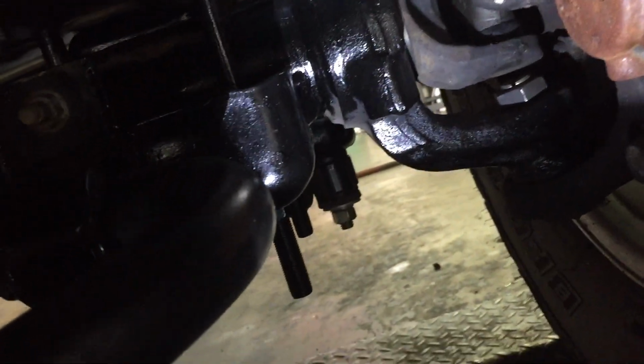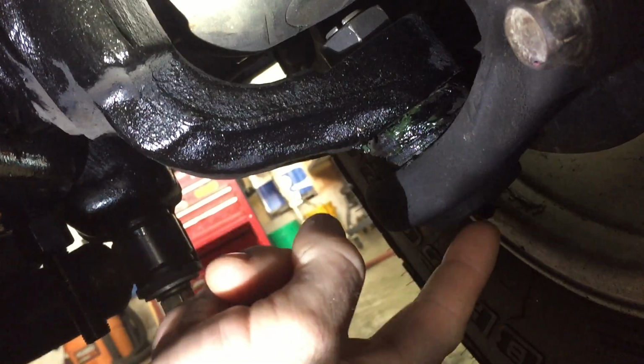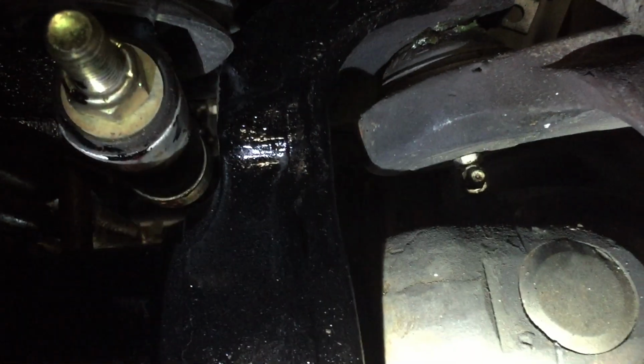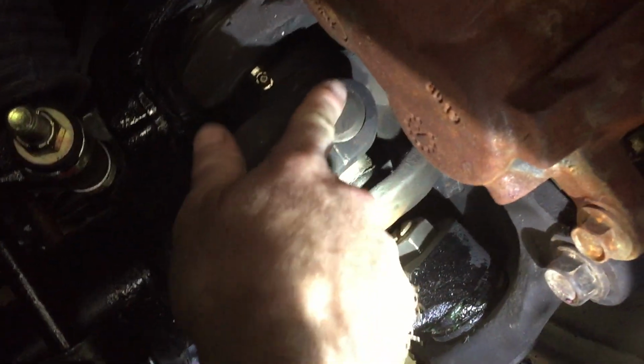Also here, there's a couple of things that you should be doing on your ball joints, guys. You can see that right there. Let me point to it. You see that and that? Now, I'm familiar with the grease zerks that come with the Moog ball joints. But in order to make this work, what you need to be doing is putting the lower grease zerk on the upper ball joint. Then you can use a 90-degree fitting that slides right over the top of it, and it'll allow you to grease it without taking it off. That will give you the clearance so that this doesn't hit the drive shaft, so it doesn't hit the wheel joint like it is right there. We can possibly remedy that just by changing the grease zerks. We'll change them out. It sucks that they're not Spicer joints in here.